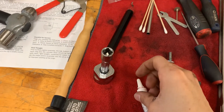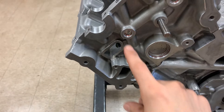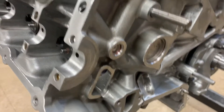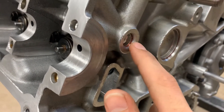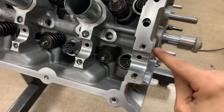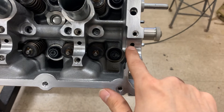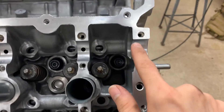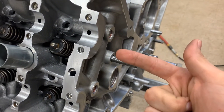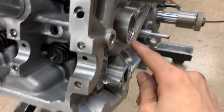You'll need to purchase Threadlocker 262 from Ford Motorcraft — that's the sealant they recommend that goes around the engine plug when you insert these. A little tip: when inserting plugs, they just need to be seated below the lip, not all the way back. Especially these first two plugs — there's an oil passage that goes to your cam journals, and if this plug is seated too far back it will interfere with that. They need to go just right below the lip.